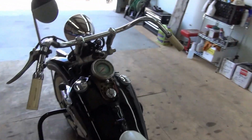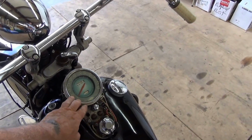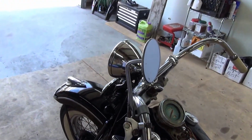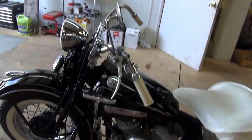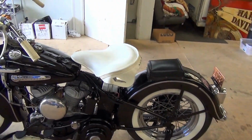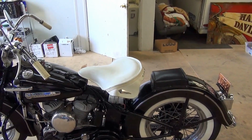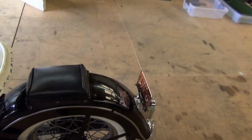Just because it goes around and spins up and everything, the problem is these speedos have gears. There's grease inside. The grease is now 50, 60, 70 years old on these old speedos, and it's gummy, so they don't work the right mileage and haven't been working the right mileage for a long time. So these original mile bikes that people say, whoa, it's got this many miles. Well, guess what? It could have a lot more or a lot less. And it's usually a lot less, because as these speedos get gummy, they start tripping too fast, not too slow. On our bug bike, the 56, the odometer is actually running at twice the speed of the trip meter, which is a lot more accurate to the actual mileage I was going. So it's actually got about 13 or 15,000 real miles on it, not the 27, 29,000 that shows on the speedo.